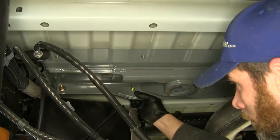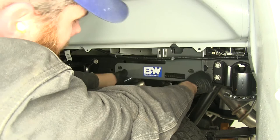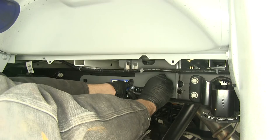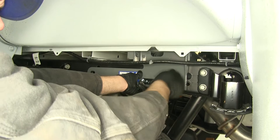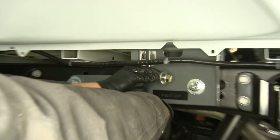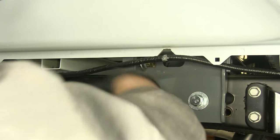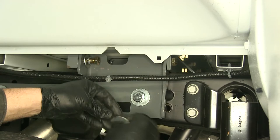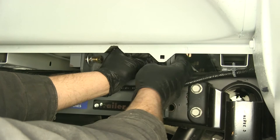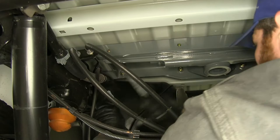Now we can get our side plates put into position. You can see our two flanges — these need to go in between the front and the rear crossrail. Those plates are going to line up with our holes right here on the side, which already have weld nuts. We'll use our 16mm hex head bolts with a lock washer and a flat washer for our front and rear location. For our rear hole location — the side plate to crossmember connection point — a half-inch bolt with a flat washer and lock washer. Then for our forward hole location, just like we did underneath, we'll bring a bolt through and add a flat washer, lock washer, and nut. Then we do the same thing over for the driver's side.